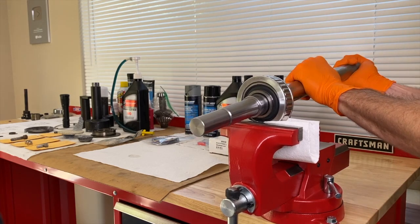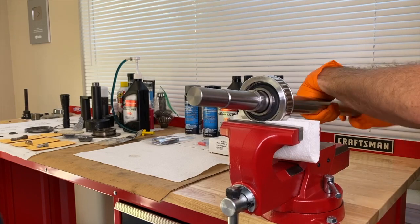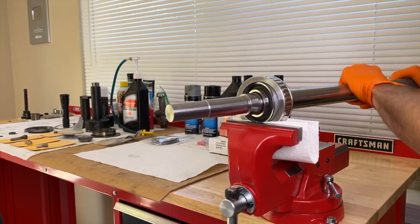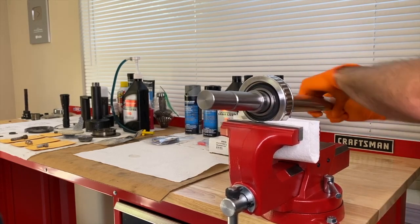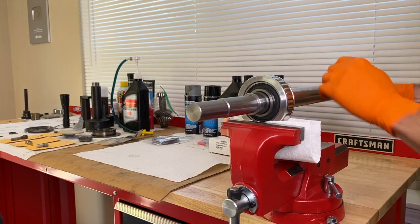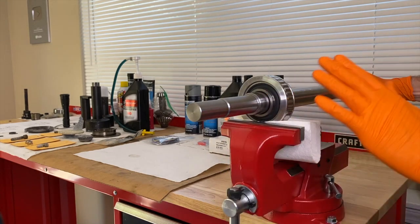As the outdrive moves — for example, check this out — you'll notice the gimbal bearing is still spinning but the internal portion of the bearing is at a different angle. We can trim it a different way, and in addition, we can turn it every which way while this drive shaft is spinning. That is the whole engineering and design around these gimbal bearings. The new sealed design, with the internal portion factory sealed with grease, alleviates a preventative maintenance item — we no longer have to grease this bearing. It's all sealed and done for us.